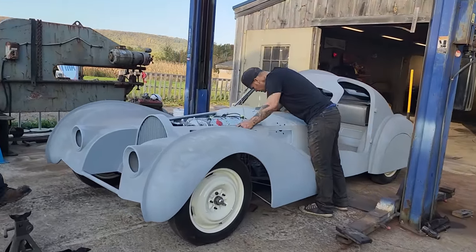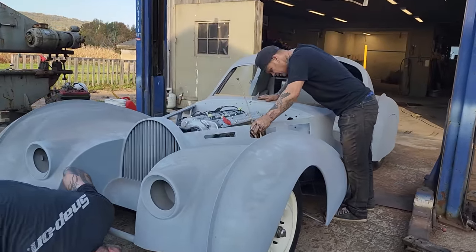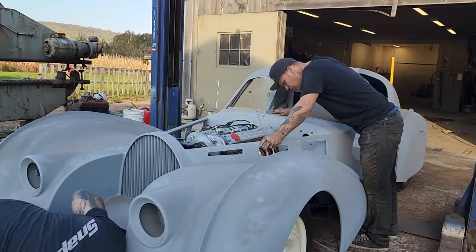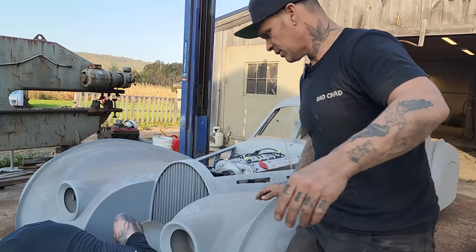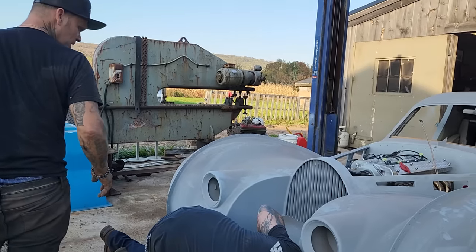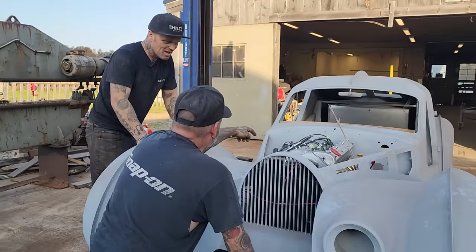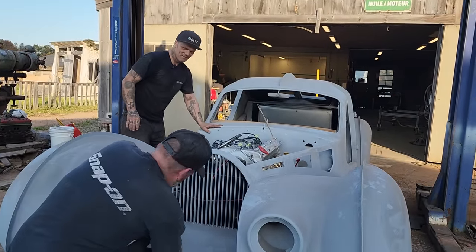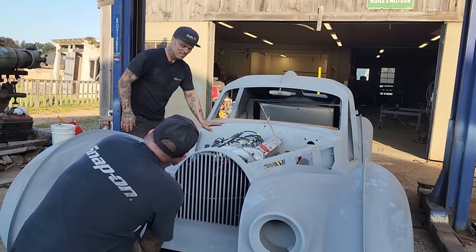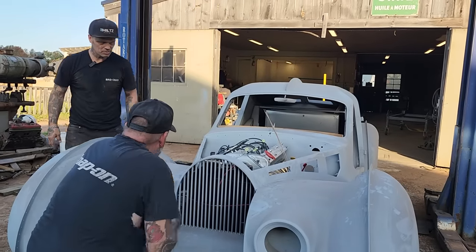The transmission stick has got to have some tweaking done. We're pretty close. We're not hitting anywhere. It's the cutouts that we did on the square stock. See, if we bring that body ahead, you see the back of the head and these bolts here? That comes ahead a quarter or half an inch. That'll miss the front of that frame. Right now it's touching. And that will miss it if we bring it ahead that little bit. Okay. We're missing that mount there.